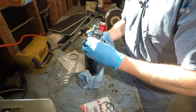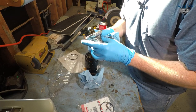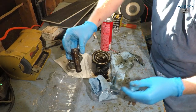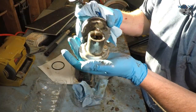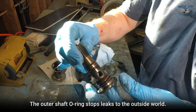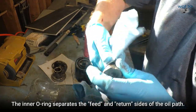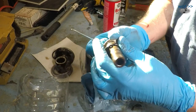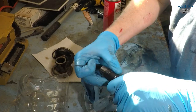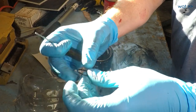There are a couple more O-rings in here that are going to have to be changed. We could try the old-fashioned way — this is wood, it's not going to bash the metal. And it worked. Two more O-rings. These are in a little better shape, but they're still pretty flat. Those are a little softer so they aren't completely fried. But that one there is a little brittle — feels like it just wants to snap and break.